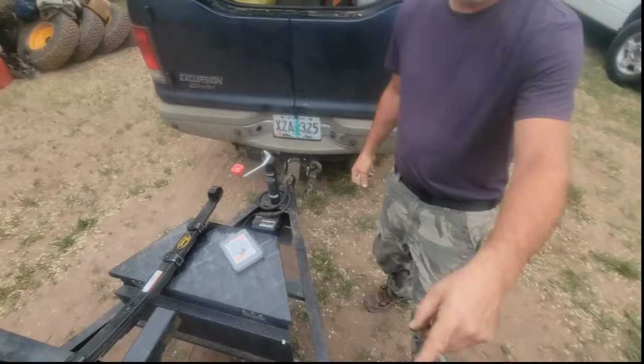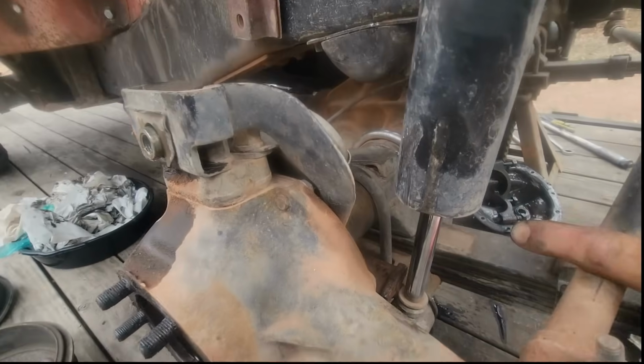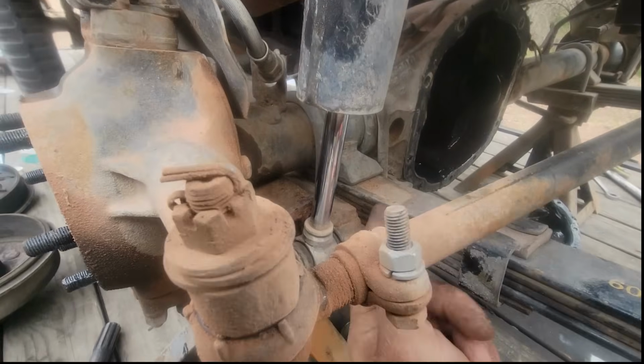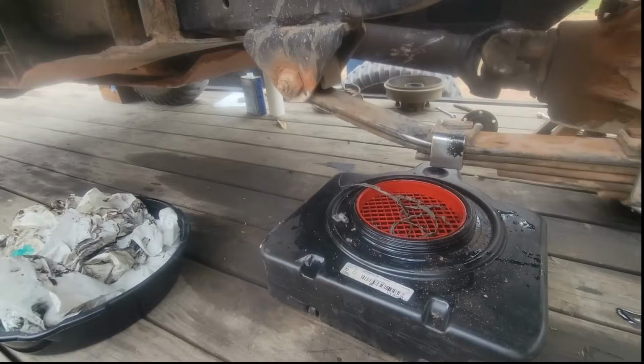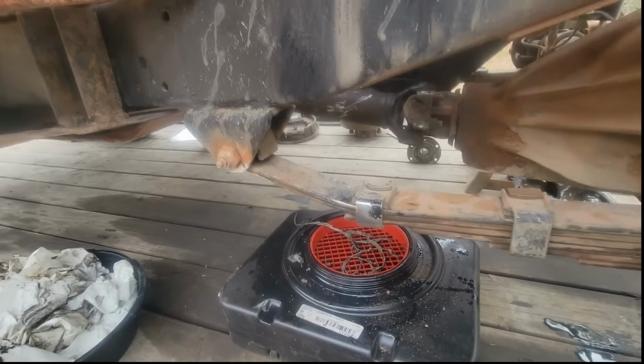Okay, well, that's a new spring. We have a broken spring bolt. You can see the axle move back 2 inches, and then it's bent. The spring's bent in the back. Which bolt is broken? The center pin. Oh, the center pin is broken. Yeah. So talking about this change right here. And then it's bent there really bad. It's not supposed to be like that normally. No, normally it'd be more of an arch. Is that okay? Yeah, just a gentle arch.